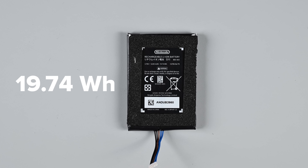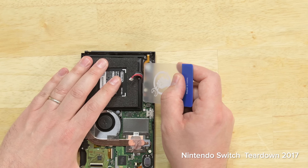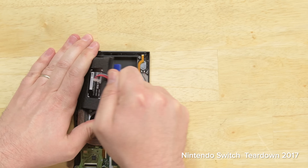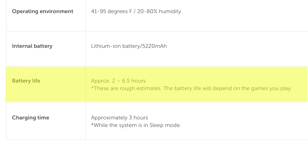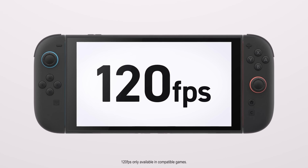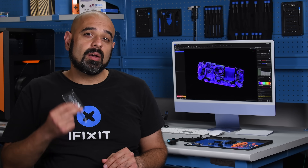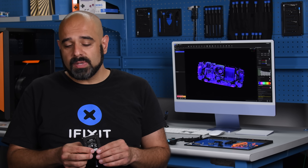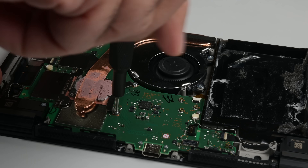The Switch 2 has a 19.74 watt-hour lithium-ion battery, a nice upgrade over the original Switch's 15.95 watt hours. But according to Nintendo's official specs, the Switch 1 and OLED models lasted about four and a half to nine hours of gameplay, while the Switch 2 right out of the box offers just two to six and a half hours. This is probably thanks to its upgraded hardware — the new Tegra SoC and 120Hz LCD. It also means that when the battery starts to age, you're going to feel it. Batteries are consumables, making them a major repairability concern; you'll get about 300–500 cycles before capacity permanently drops to around 80% of original.